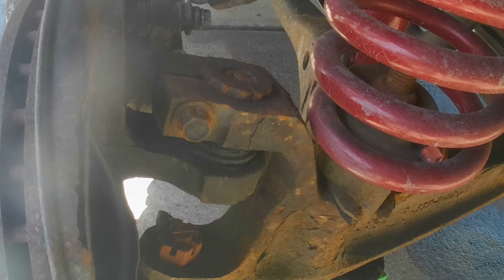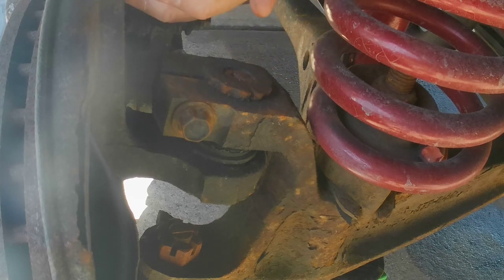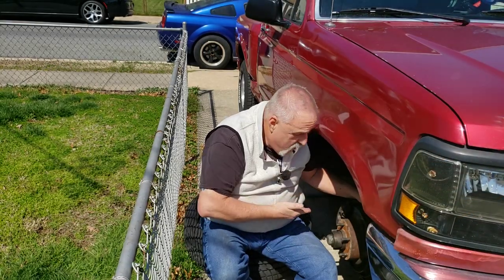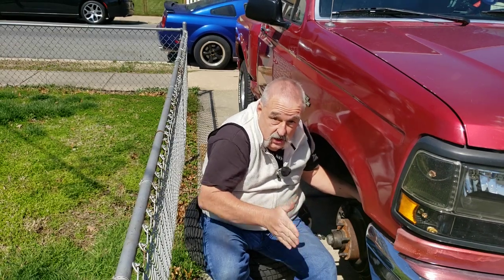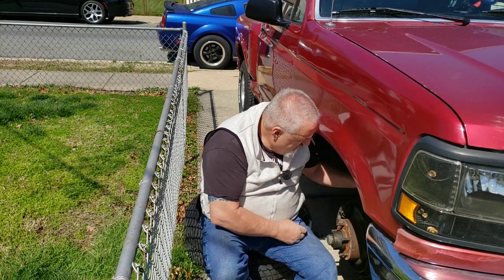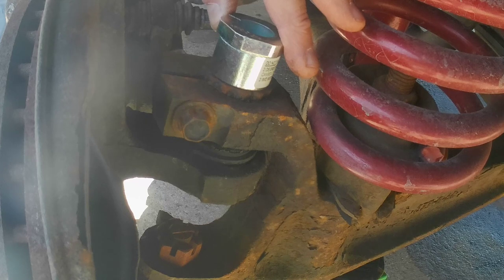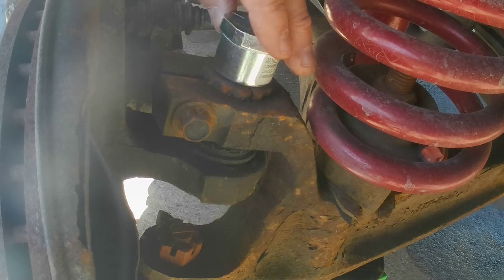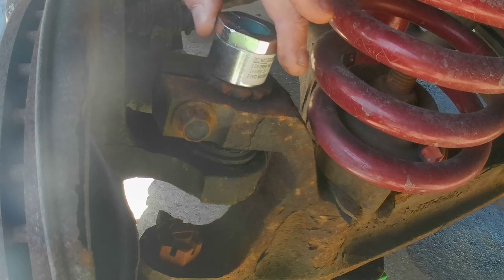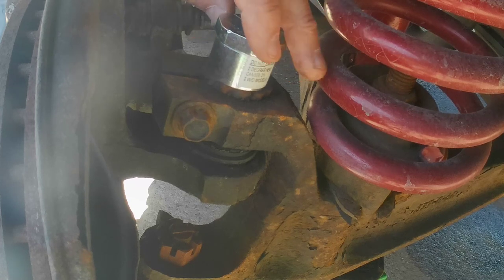All right, let's figure this caster thing out. This is the new one that's going to go in it. So that means it's pulled all the way here. That means my axes are this way. And this wheel is pushing that caster. It's not bottom. So I want this to be around here. Now, mind you, it's going to be this one here. I want it to be on this side. Once it's on this side, then that's caster, and that'll be fine wherever it is on the side. And then I have to adjust it so that we have the camber, which is this, right? This is the one we want to adjust. The caster's going to just be fine. You've got two choices, positive or negative caster. The camber, yeah, we're going to get that adjusted up.